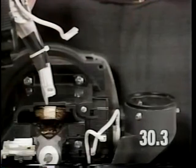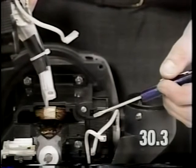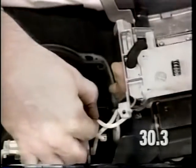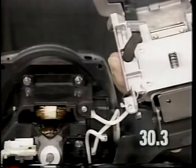Install the shorter headlight lead wire into the opening at the power switch near the power switch mounting screw. Make sure that the wire plugs securely into the field terminal. Install the right brush lead wire onto the lower terminal of the power switch.